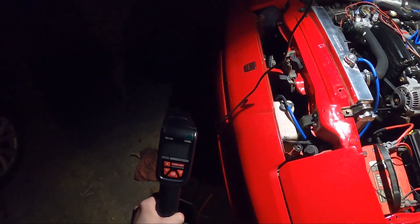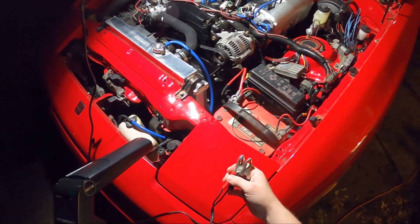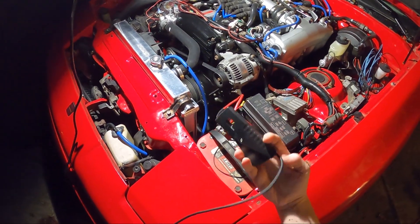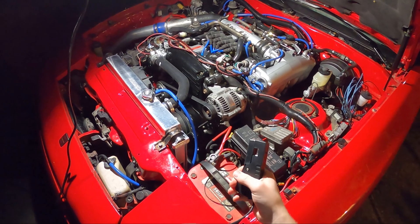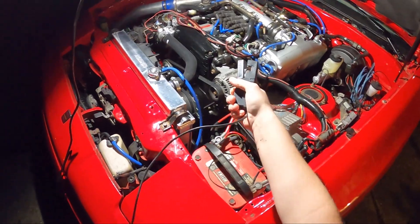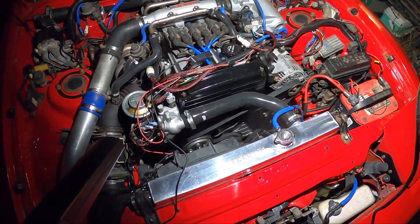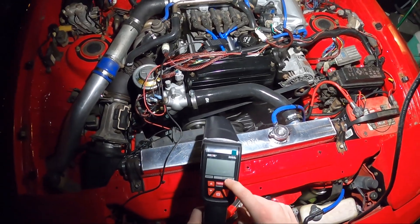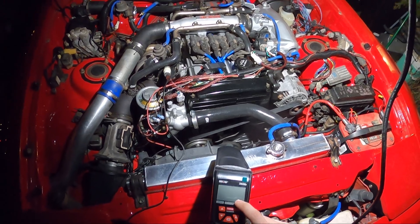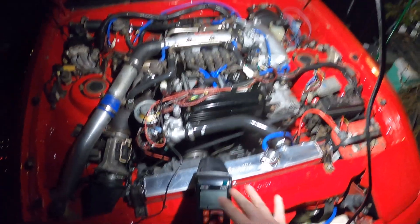All right, we're out here at the Supra. I got the timing light here, so there's a few things to this. The timing light needs power — you're going to hook it up to the battery. And then there's this little thing right here, this is an inductor. We're going to put it on the number one spark plug wire, and what that will do is allow it to read whenever that cylinder is firing. And this one's kind of a fancy one — it will show the RPM that the engine is at, which is great, so I don't have to go back and forth. I can see that it's at 650 or around 650.